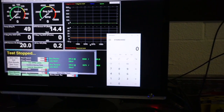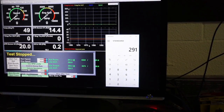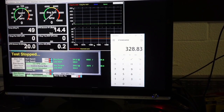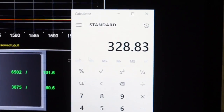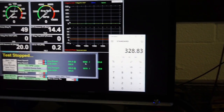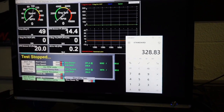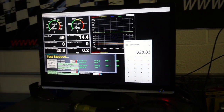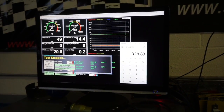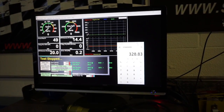That's like 320, so applying 13% correction that's 291. We almost hit 330 and we didn't even do the pull all the way up to 6800 RPM. I'm going to lower the boost now because it's just too much. If you had the meth kit I could stay at 19 pounds, but I think it'll be safe at like 17. So I'll probably walk away with like 320-ish.